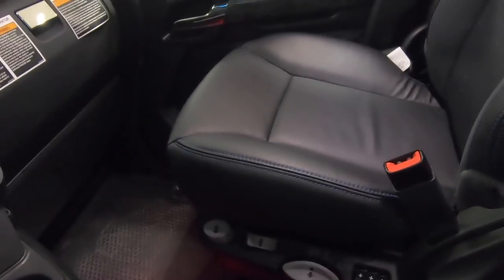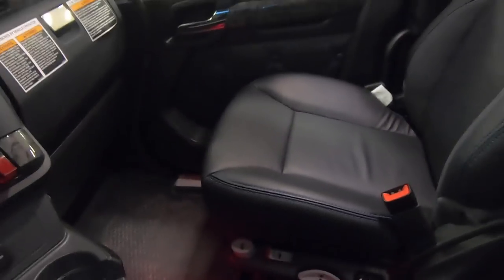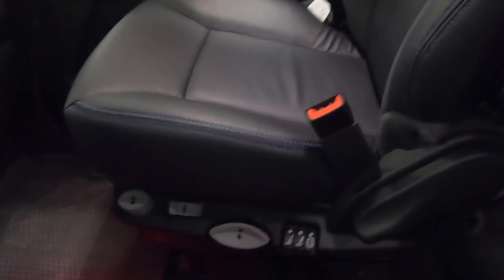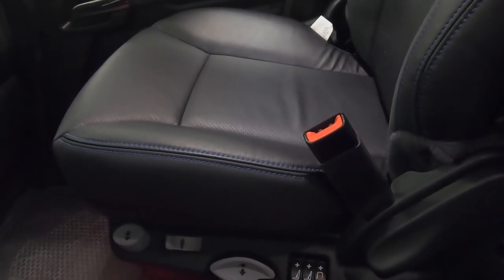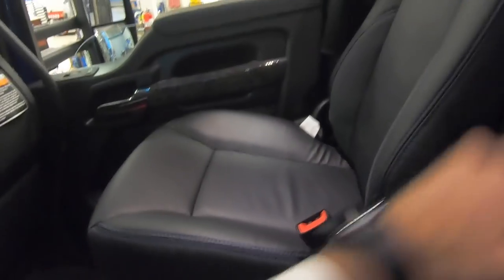This has the passenger seat that swivels around, so I'll show you how that works in a minute. As far as the functions on the side here, this is a quick release to drop all the air out. You hit that again, and then it goes back to the last setting. This is to adjust how much you want your shock to be more stiff or softer. This is your height adjustment. And with the GT703 seat, you get the additional lumbar support, so you have three lumbar supports as opposed to two. This here adjusts your tilt on the back.